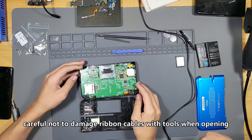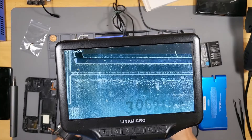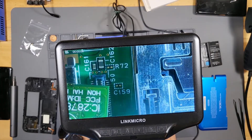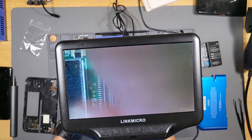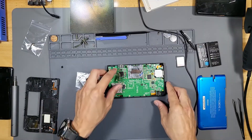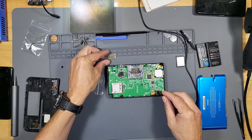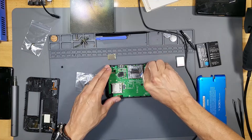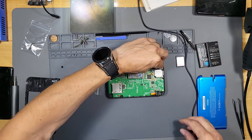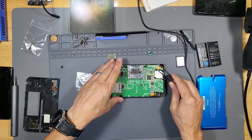Remember how you took everything apart? What is this — buttons? Where does that go? Right there. Let's unplug a couple things and see if the unit turns on. The WiFi card is right here. Let's go ahead and unplug that, and then let's unplug this one as well — the IR sensor I believe. Yeah, you can see the IR sensor. And this one is for the camera, so let's unplug the camera.